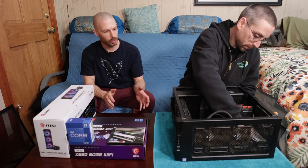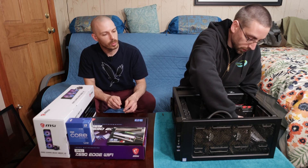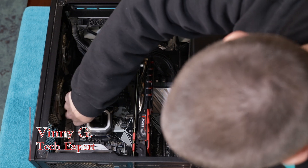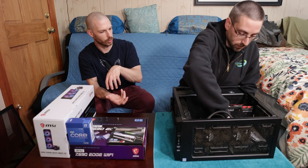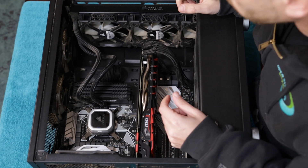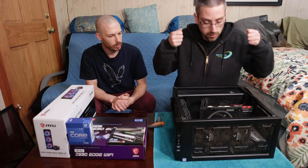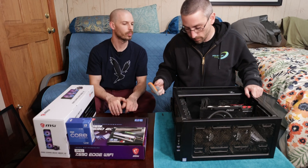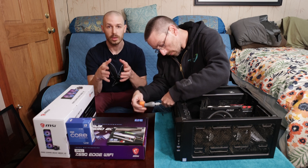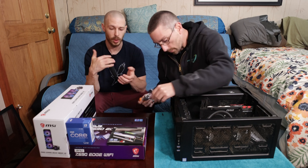First order of business is to remove the liquid cooler. That's held in by these four nuts here with this Corsair cooler. There's a bracket underneath the motherboard — it's a back bracket that comes through the motherboard and connects to these studs that we're unscrewing. We're going to leave the block there so it's not flopping around the case, then dismount the radiator and take it out in one fell swoop. The liquid cooler has a radiator on the front held on by a few screws. Removing those screws lets us remove the radiator with the fans mounted to it — really the biggest part of the liquid cooler itself.